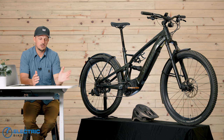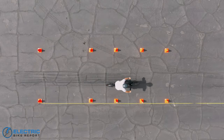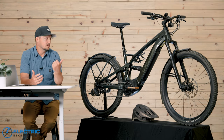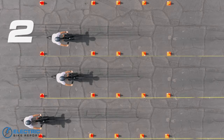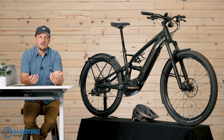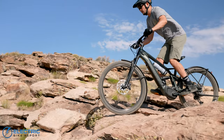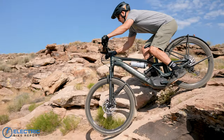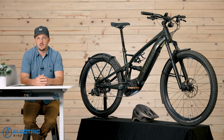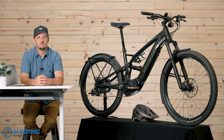We saw that in the results. On our brake test, Griffin — who's 230 pounds — gets up to 20 miles per hour three times, stops three times, and we take the average. The Taro X's numbers came in at 21 feet and 11 inches, which is really good. Out on the trail at Gooseberry, I pushed the brakes hard on some steep rollers and it was very comfortable — no squeaking, all the stopping power, good modulation. Two thumbs up on the brakes.